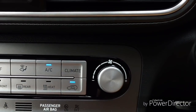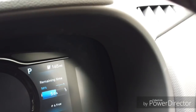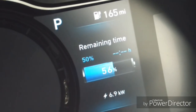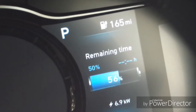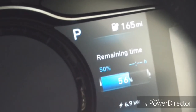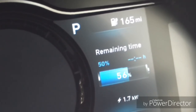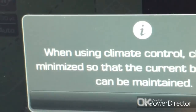Interestingly, if we zoom in over here — at the moment it's charging at 6.9 kilowatts, and yet I didn't ask for a charge. That's because it's trying to maintain the battery and range at the same level without impacting anything else while doing this pre-conditioning. So it's not using your range up or your battery — it's drawing current from the grid to power it. It gives it an initial burst and then reduces down to just the amount of electricity it needs. The ignition's gone off now because I've turned the car off.